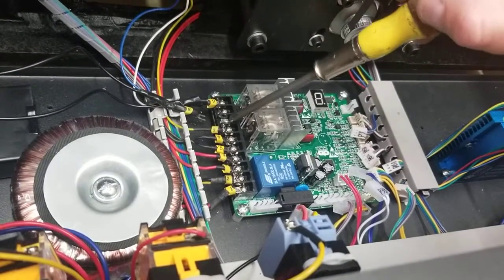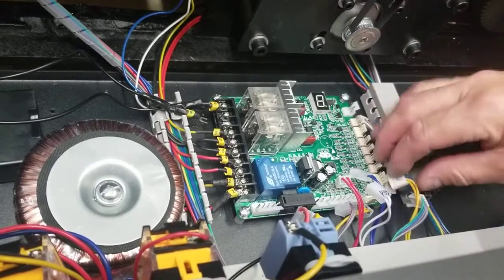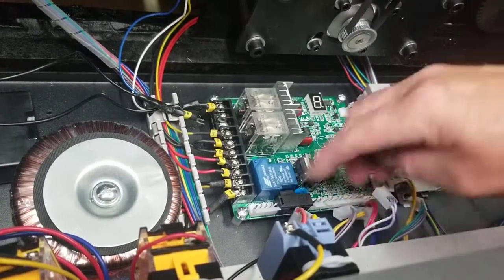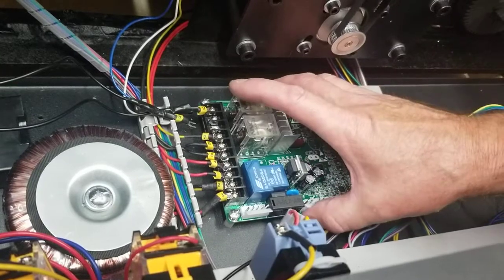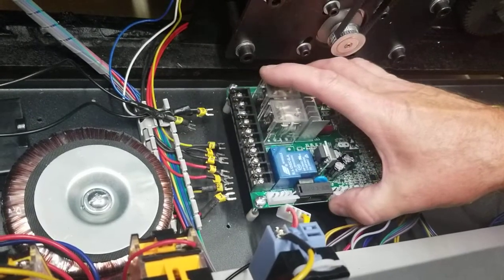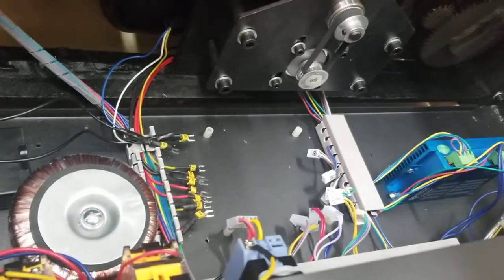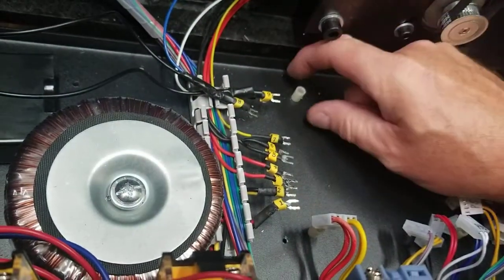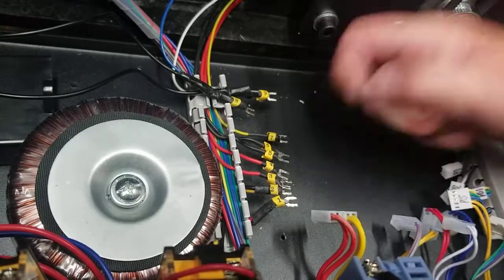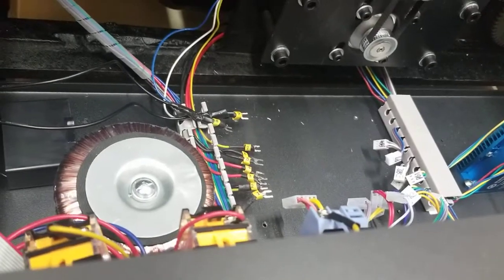Okay, I got these completely loose — they're still there but they're completely loose from the screw hole in the frame, all four of them. And all nine screw terminal positions are loose too. Basically try to get these out of the way as much as possible. Then I'm just going to lift straight up and all these should just slide out because I got them all loose. You can see these all slide out — pretty simple. Take your board up. Sometimes the plastic spacers will still be on the screws; in this case they all stay down and you can see these are loose plastic spacers. Find all four of those.